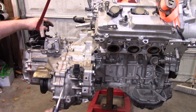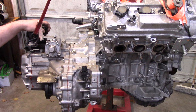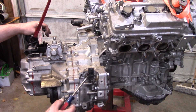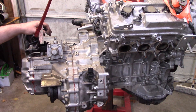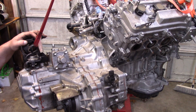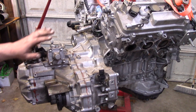If you're concerned, you can get the front half of the transmission from a Solara — it'll have those mounting patterns, and at the same time that Solara transmission will get you the 3.9 final drive, which is really nice to have. The Solara has all of the same one through five gear ratios as the E153, except it's got the slightly taller final drive, which is nicer to drive, and it'll have the newer bell housing. So if you want to make a hybrid transmission, just remember: since you're using the mid case from the MR2 and the bell housing from the Solara, you're going to have to reshim your shafts.